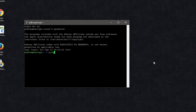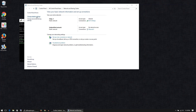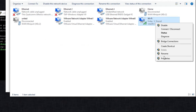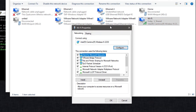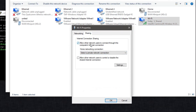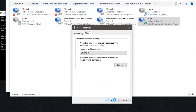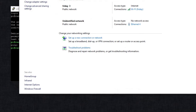If you go to ping, it won't work because there's no internet yet. To set up internet sharing, right-click on your network device, go to adapter settings, and find the device you're currently using — for me that's Wi-Fi. Right-click it, go to Properties, then head over to Sharing and check 'allow other networks to connect.' Select Ethernet 4, which is the Raspberry Pi device, and hit OK. It will set up all the parameters, but you'll need to force a reboot on your Raspberry Pi for the internet to start working.